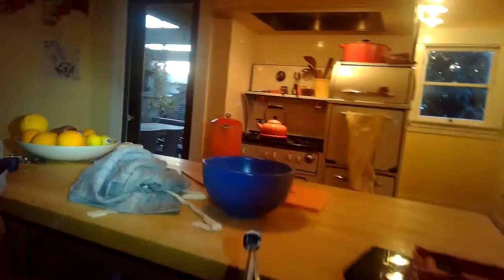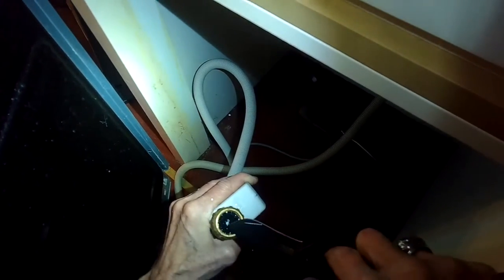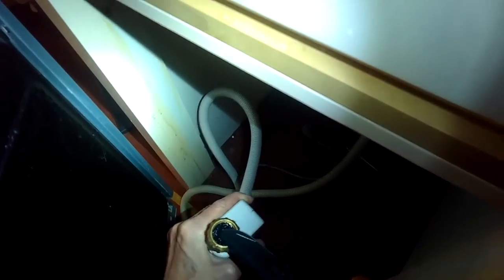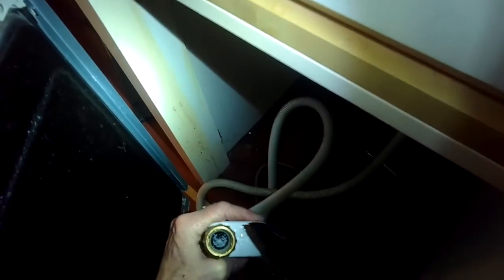So if you clean this out, you may have to get a new rubber gasket that'll fit in there. I'm going to grab the filter with a pair of needle nose vice grips. You can see it's covered in black rubber debris from the gasket that just kind of fell apart over time. I'm pulling out that gasket and then I can pull out that filter, clean it up, and then put it back in.